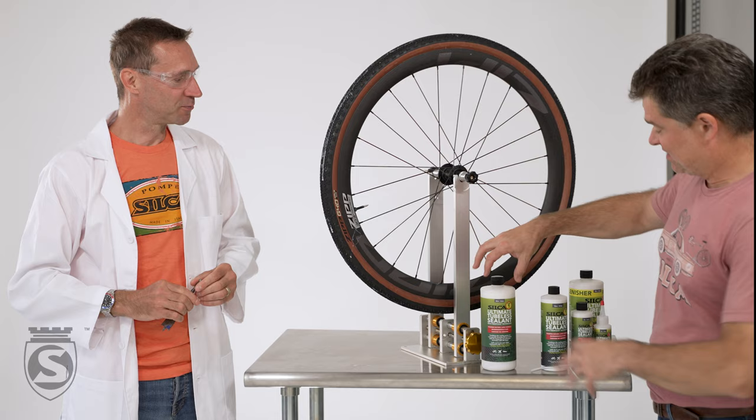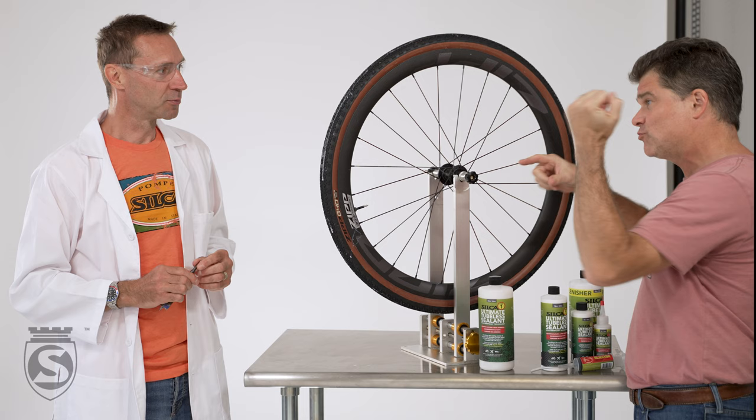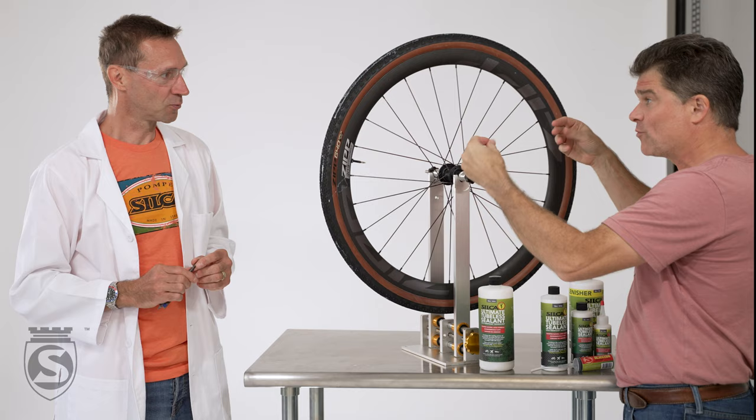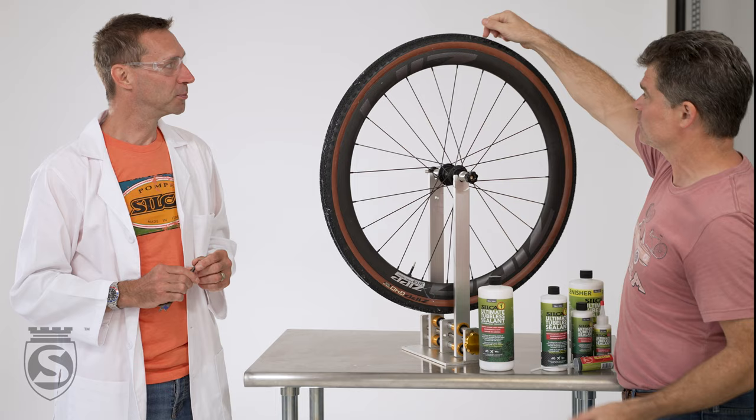What's the secret? What's in your product? It's a liquid latex, natural latex, which is what a lot of tires are made from. But we've got carbon fiber strands that form what we like to call a carbon dam. So as you puncture it, the sealant — which is why we spin it first to get the foam in action — the foam bubbles all go towards the puncture and they carry the carbon strands with them.